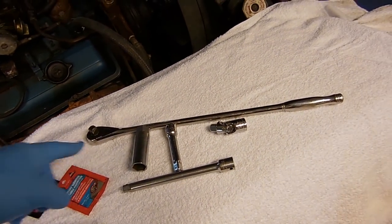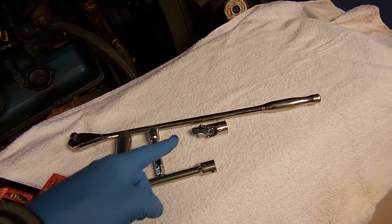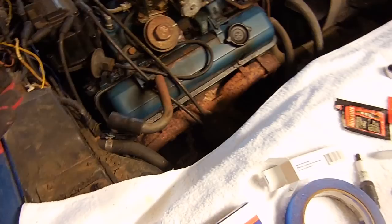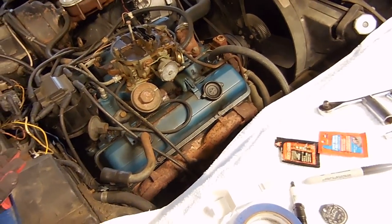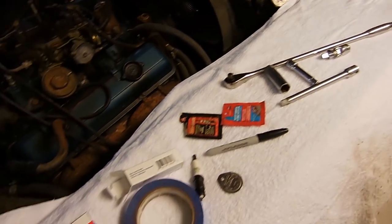And then your tools, so you need a wrench, you need a 5/8 plug socket, a set of extensions, and sometimes a swivel. On a C3, it's not too bad to do the plugs. It's not like having a C4 where you need a whole bunch of different stuff. You should be okay with just these two, but I included them just because you never know.